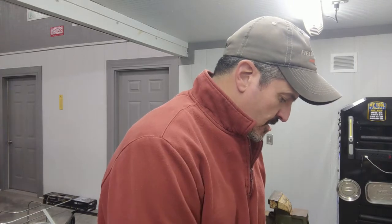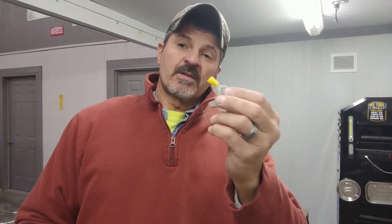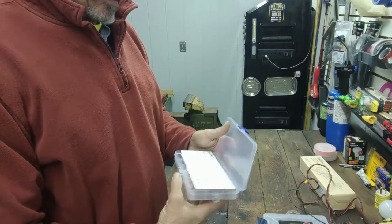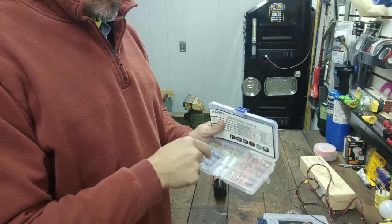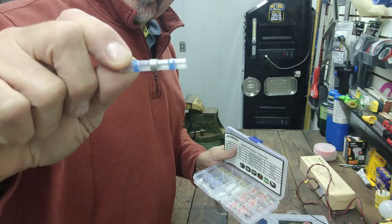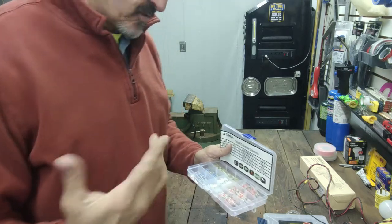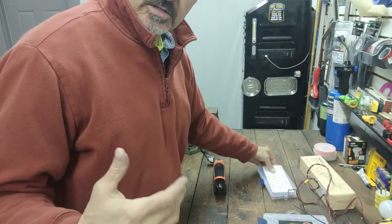What I did was use a bigger eyelet. I also took off the yellow coating for two reasons: mainly because I can use heat shrink tube fittings to make a nice tight connection. I use these heat shrink connections with solder in the middle — you push the wire in from each end until it hits the solder, then you heat it up, the solder melts, and it shrinks. But I still don't fully trust that alone, so I continue to add a heat shrink over the top of that as well.